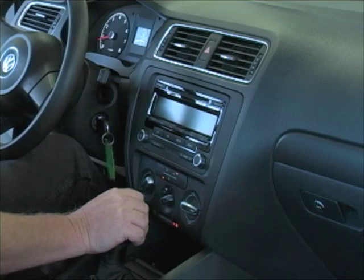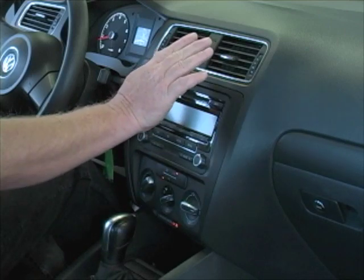The first step you want to do is set the air conditioning for max cool. Max cooling is going to be when you have the air duct selected for the center vents, temperature is set to maximum cold, the AC and recirculation door is closed, and the blower is set to high speed. This isn't going to get cold right away — give it a minute or two, but you should notice if it's getting colder.